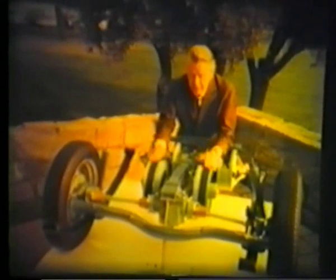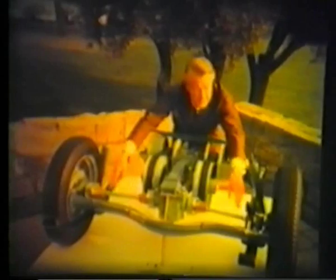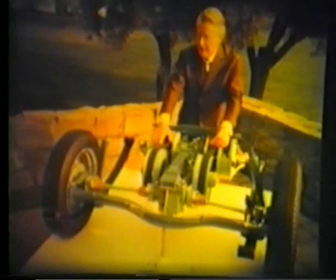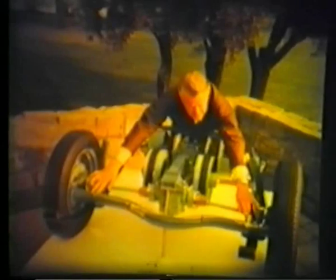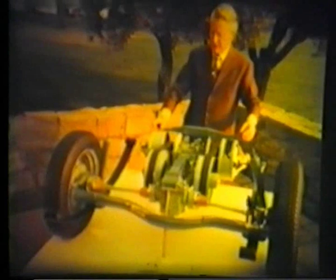On the new arrangement, these pulleys feed back into a central reduction gear, then to a conventional differential, and the power goes out through two universally jointed shafts to the wheels. Now here's the expensive feature which DAF alone have on a small car — the de Dion axle. This tube across here keeps both wheels parallel, moving up and down vertically, no matter what you do.